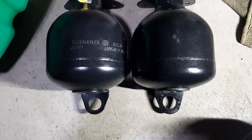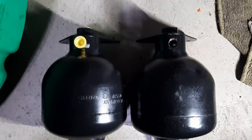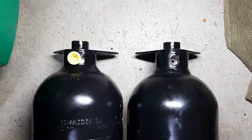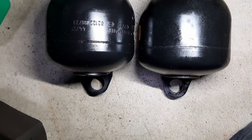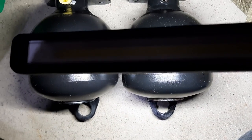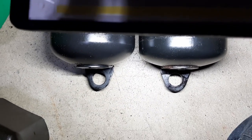Okay, I figured out why the protection cap won't fit on the Febi Bilstein unit. So you can see the dimensions. Let me move my light a bit. The length is correct, but look at the profile of this curve, especially in this corner here. You can see that the BMW unit is more square, but the Febi Bilstein is rounder, probably to be compatible with more cars. That would be my guess,